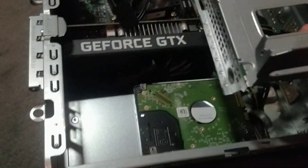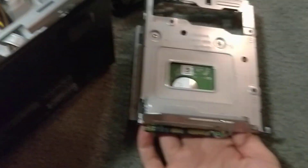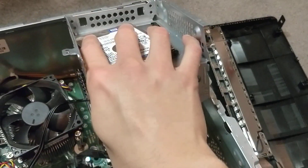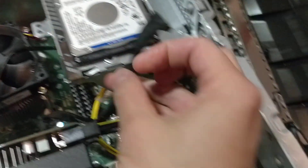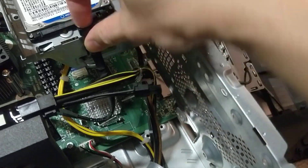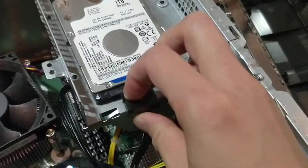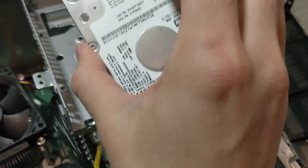Pull it out — and then you should be able to stick your SSD in, screw it in. Then you flip it over, put it in, drop it in, and attach the cables. Attach the power one as well. This could be an SSD or a laptop mechanical drive.